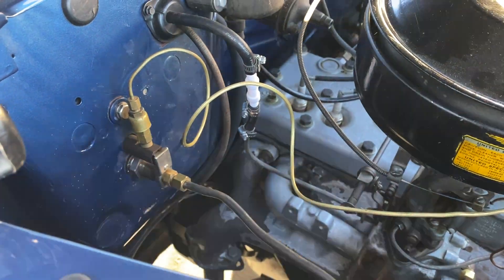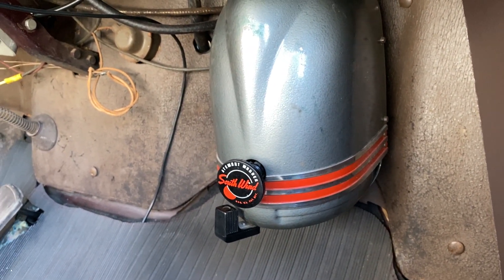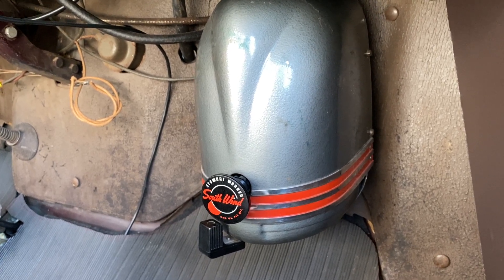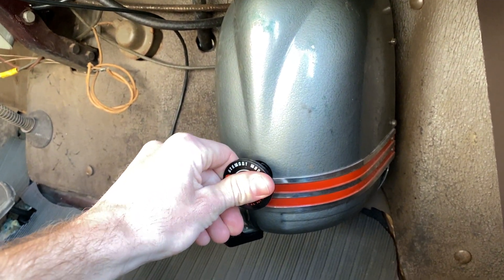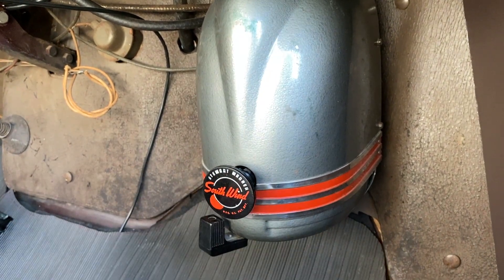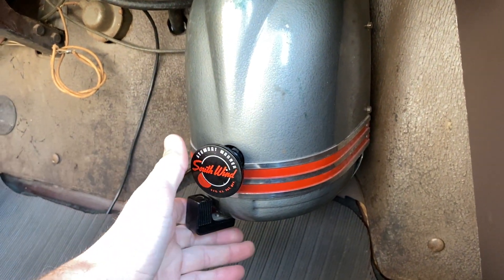Let's take a look inside the cab. The heater's running already. If all is properly connected and hooked up, it should start within 90 seconds — at least that's what the advertisements say. I've had some issues with that, but that is due to a small speck of dirt inside that jet tube, which clogs the hole and the gas isn't efficient enough. When you first start the heater, you pull the knob all the way out, and that starts the siphon of gas. The igniter turns on and glows hot red, and eventually the combustion chamber gets hot enough that the fan will turn on.